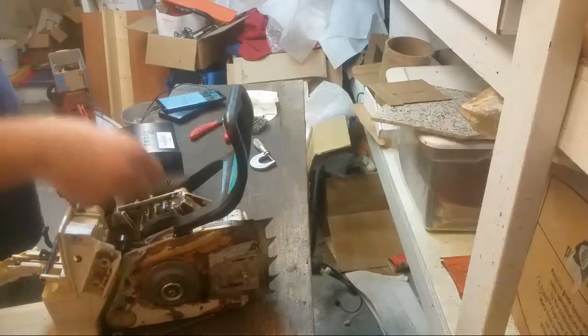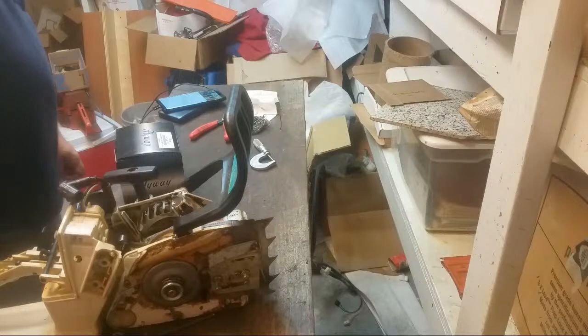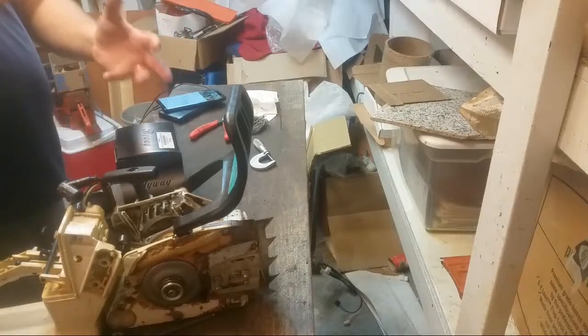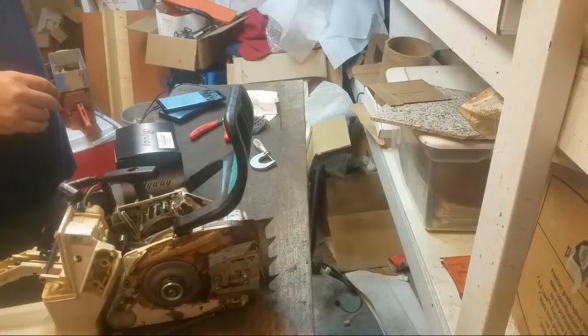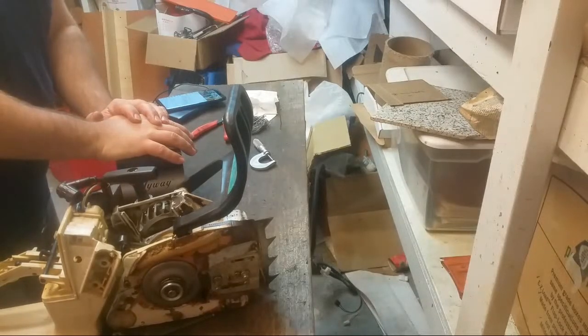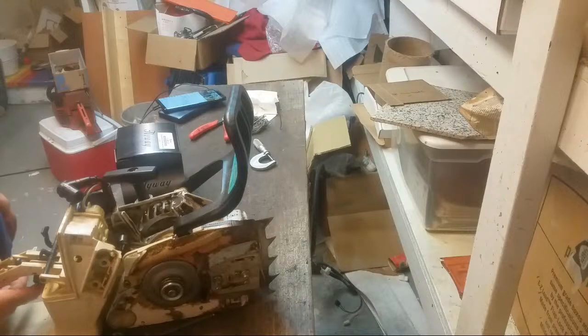I will try to explain that better, hopefully after this comes back from being machined. So there's a bunch that goes into it. Once the machining is done, once the squish is accurately set with the right gasket, then I can actually do the port work on this. But at least I have an initial number that's probably pretty darn close.